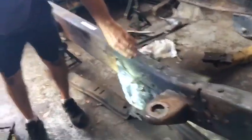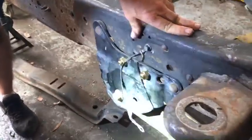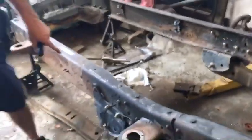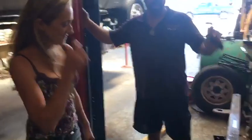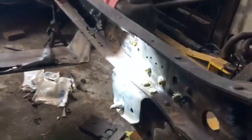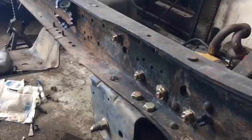Here's what we're using. We're going to be replacing this and all those to make this four-wheel drive work underneath the two-wheel drive. So I knocked out a bunch of those. I got this one and this one to go. We're going to use our lovely assistant to get our torch hot and knock it off with an air chisel. However, you can also do it just by crisscrossing it with a cutoff wheel, like Swiss cheese, and air chiseling it off, and then drilling 2/3 through, and then air chiseling it out. That's one person, not as fun.